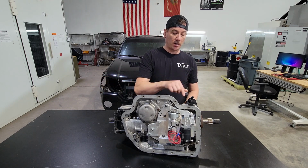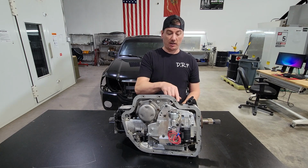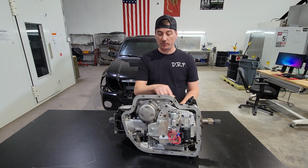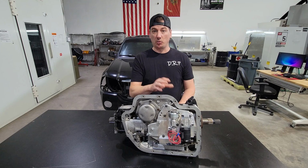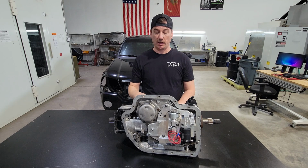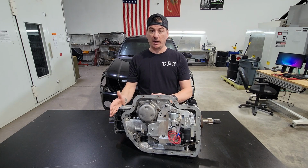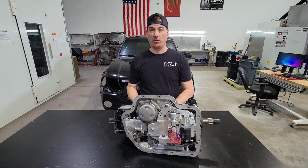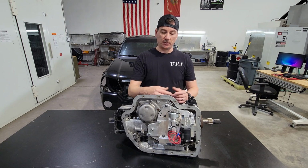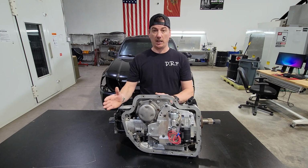All right, so it goes through there, through the back of the pump, into the forward drum. And from there, what it's doing is going through the shaft. So you'll see like a hole in your intermediate shaft. What that's doing is carrying cooled fluid all the way through, lubricating your thrust washers, your thrust bearings, your bushings, okay, your gear train. It's lubricating all of these components back here, but that's its majority focus. Okay, it does some on the bushings and kind of seals that are in between the drums here, but its primary focus is to be able to lubricate everything back here.